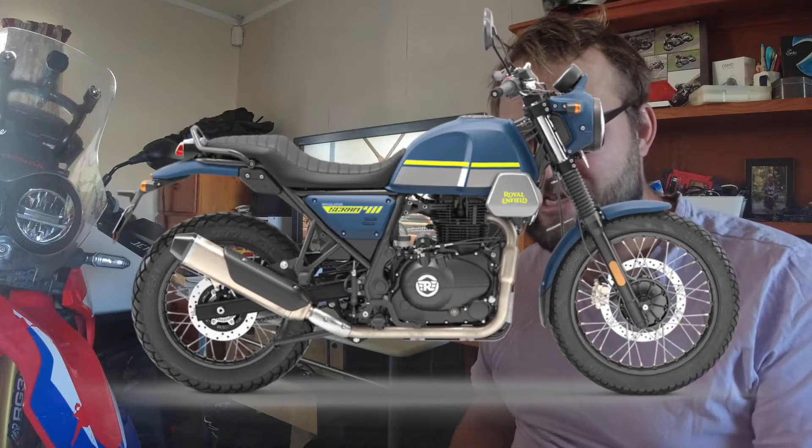That's not to say it won't handle gravel roads. Royal Enfield has fitted it with a 19-inch spoked front wheel instead of the 21-inch from the Himalayan, so this could be a bit more fun in the twisties and around town. They've got dual-purpose tyres on it — what spec we'll actually get in New Zealand and Australia is yet to be confirmed — but I imagine it'll be decent to bomb around on back roads and gravel roads; you might even tackle a couple of trails if you're brave. It hasn't really lost much capability compared to the Himalayan. 20mm less ground clearance is tiny, and while the smaller front wheel might make obstacles a bit tougher, the bike is 6 kilos lighter, which you'll definitely feel.